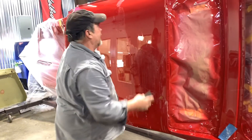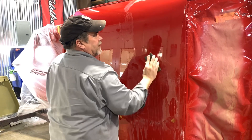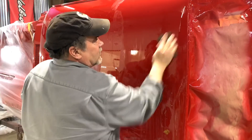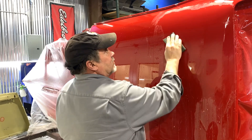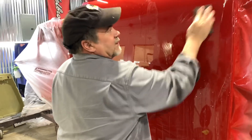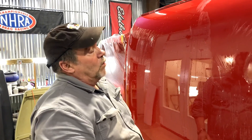Keep the paper clean, because it may not seem like it but your clear does build up in the grooves of the paper. That's simply because it's such a fine grit. And this isn't even the finest — this is just the first one. You can go as low as 800 or 1000 on your initial grit if you've got a real heavily textured or dirty paint job.